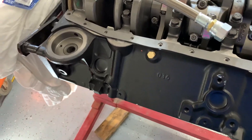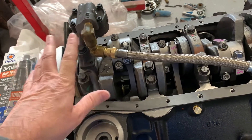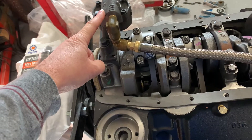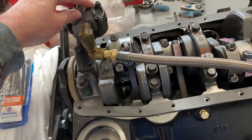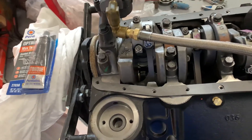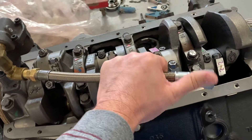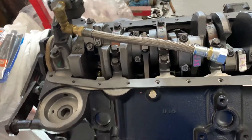Our bottom end is buttoned up. The oil pump is torqued to about 60 to 70 foot-pounds. We have the oil pump plate on the bottom, tapped to the correct size for the original sump fittings, reinstalled at about 80 inch-pounds. We've got our new hose installed with the fittings tightened, so the only thing we'll be connecting once the pan is on is this fitting onto the sump pickup that bolts into the bottom of the pan.